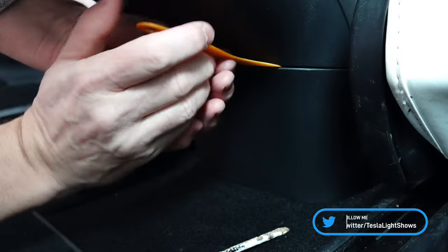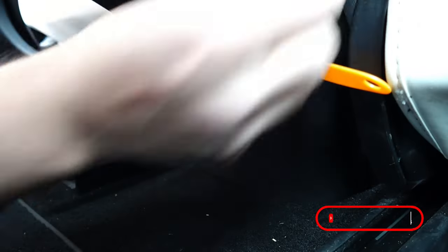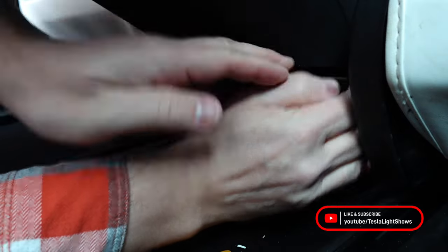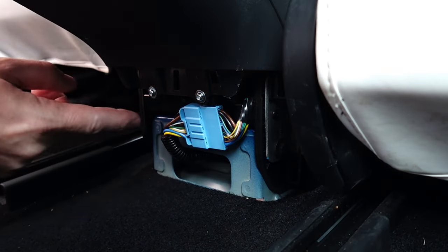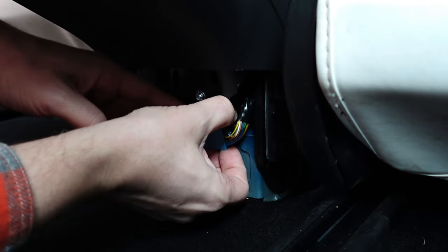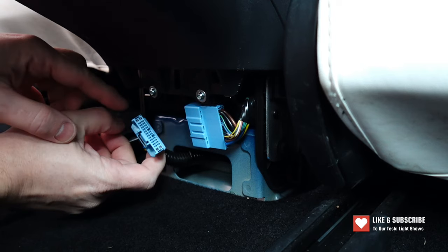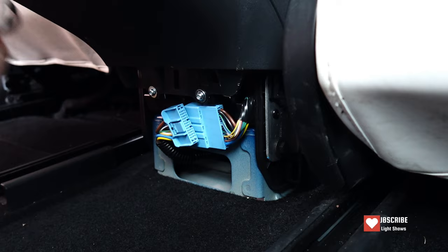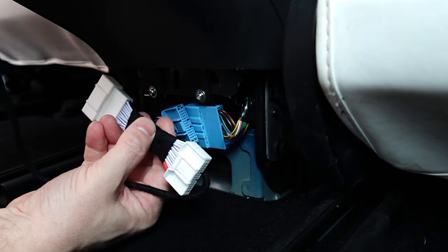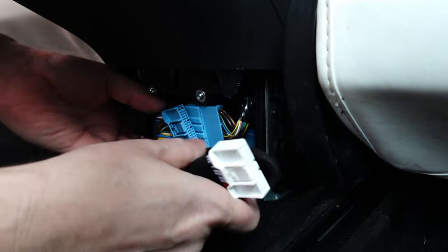The removal of the actual lower casing is the part I'm most concerned about — it's a lot tighter than the vent. We'll go ahead and use our tool again; I'm using a rusty old screwdriver, but it should do the job. Now we've exposed the cables at the rear — these are effectively the car's main artery — and into that we're going to connect up the replacement console. This bit's a bit fiddly because the female side is actually fixed to the chassis. The cables supplied are actually quite stiff, but these connectors allow the media unit to tap directly into the main data artery so that it can communicate with the onboard computer.